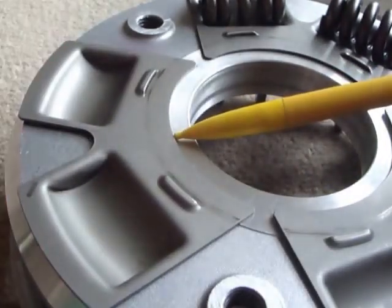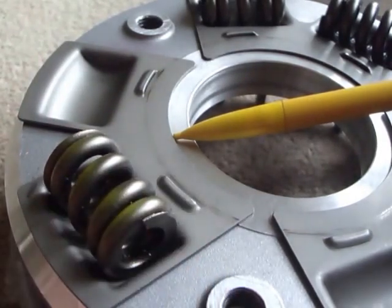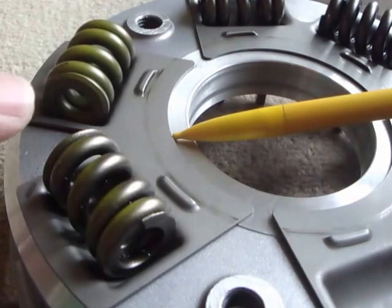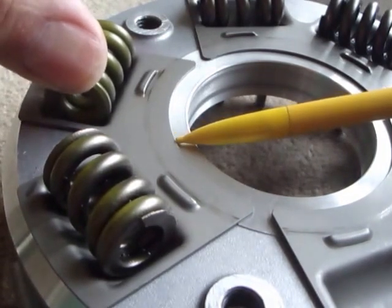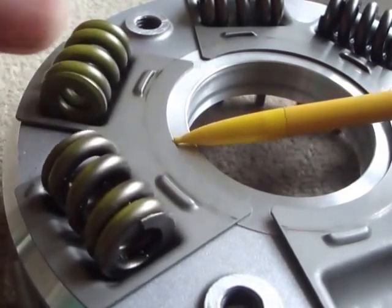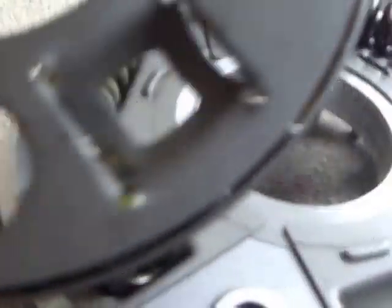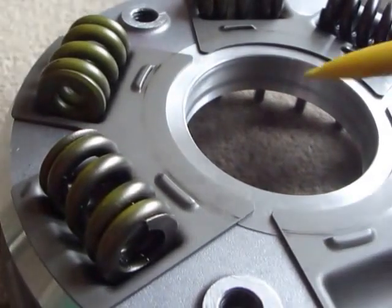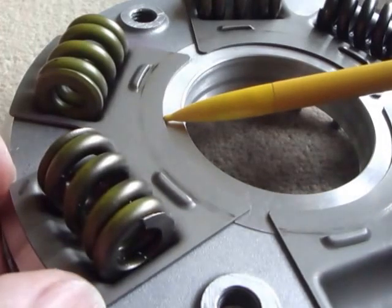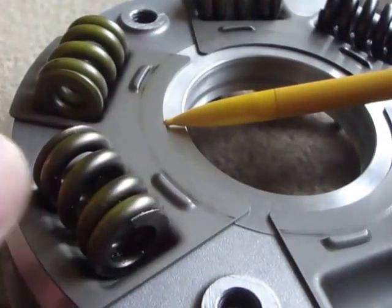It's worse as well because the first phase of spring pushes the plate along and lifts it, then the second phase of spring comes along and when that one gets the gear pushing on it, it pushes it back down again. So we've got this jumping up and down motion of the three segments. That's very close to what was going off in the Suzuki, but in that one we had all the segments fastened together in one continuous plate. In the Yamaha it's a lighter piece of metal moving about, but we've got all three pieces of metal having a mind of their own, jumping up and down according to the loading of each spring and the position.